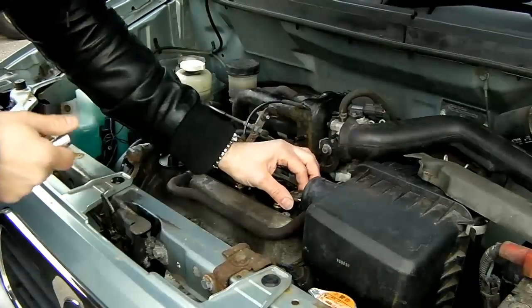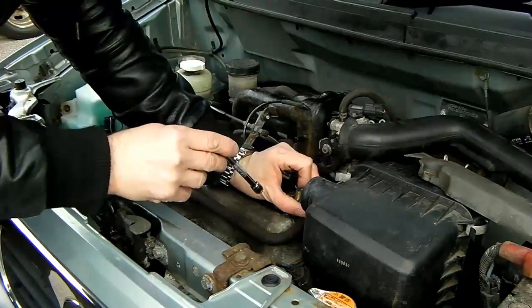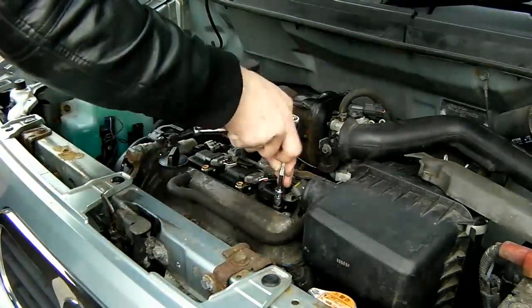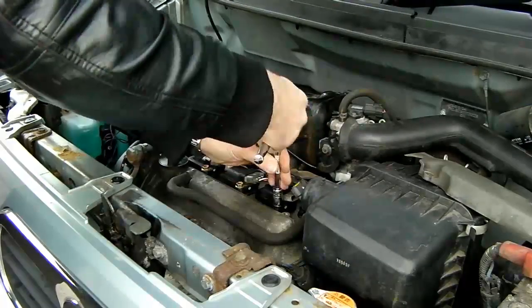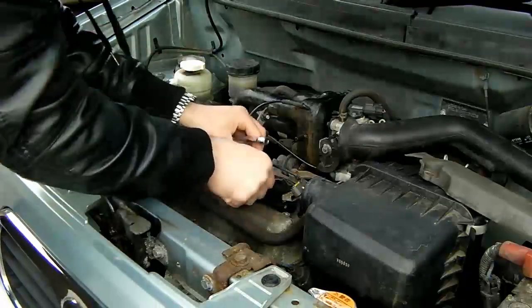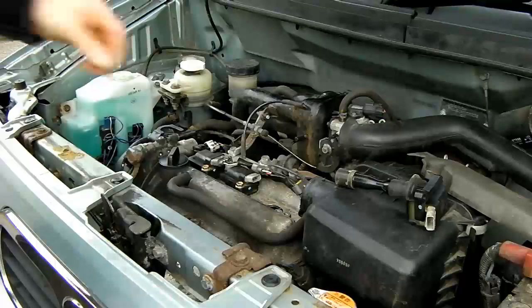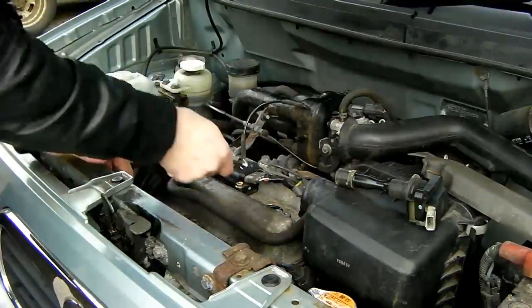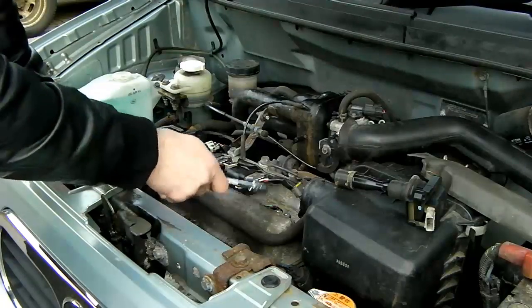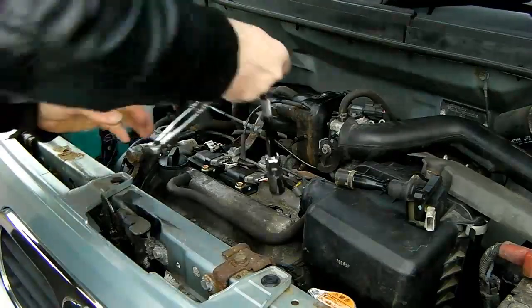Underneath you can see the coil packs. I'm going to change this one at the end here. Pull off the little connector - careful that you don't lose the O-ring, which is actually shaped in the shape of the connector rather than a true O, but hopefully you'll know what I mean. Then we've got one more 10mm bolt here which holds on the coil pack. Remove this bolt and wiggle that free, and then we have access to the spark plug down this little hole. I'm doing this one rather than in order one, two, three because it has an incorrect spark plug fitted, which I'll show you in a moment.